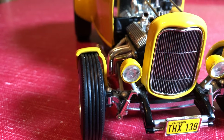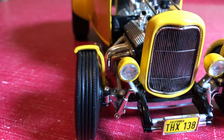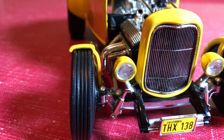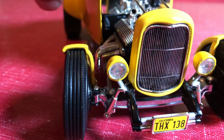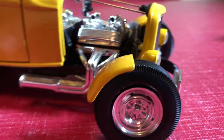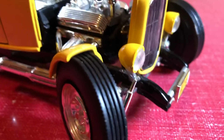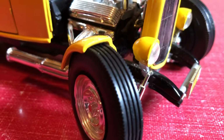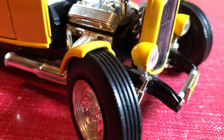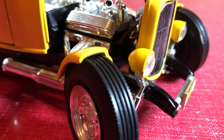One of the other things is that I've unhooked the front shocks here because they were up into the light stands, and I'm going to try to build a little bracket off of that and put the shocks to it. I might make new shocks for this because these shocks are also wrong. On the front frame horn, I don't know if you guys can see that or not, there's two pieces under it. There's another piece under the front frame horn, and they kind of doubled up the spreader bar for the license plate. I'm going to remove that piece underneath and do it right so it's correct.